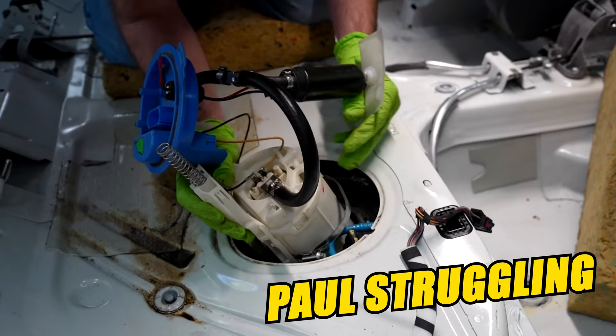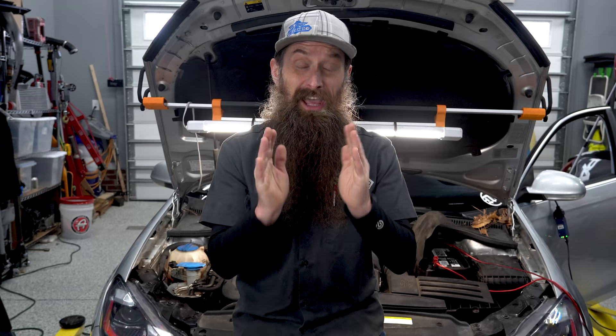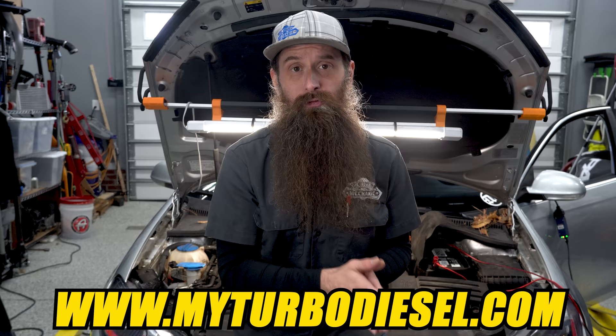Pretty straightforward and easy job, especially if you don't find any damage when you take the filter out. Now if you do find things like metal or debris, we need to go a couple of steps further. That usually involves pulling the in-tank pump out for inspection and possibly cleaning. That fuel pump's located underneath the back seat, like almost all Volkswagens. If you find metal, you're probably in for a pretty bad and expensive day. When we were doing these repairs under warranty many years ago, this would be a $4,000 to $5,000 job, because everything the fuel touched needed to either be cleaned like the tank, or replaced like pretty much everything else. These fuel filters are due every 20,000 miles — you want to make sure you're on that schedule regularly so that if you do run into a minor issue, you can hopefully catch it in time. Also, we fill up at pretty busy fuel stations so they're turning through diesel fuel quite regularly. We'll have links to everything we use down in the description, including the link to the article from MyTurboDiesel.com showing the different filter housings.